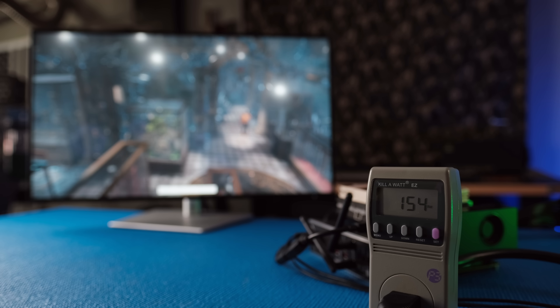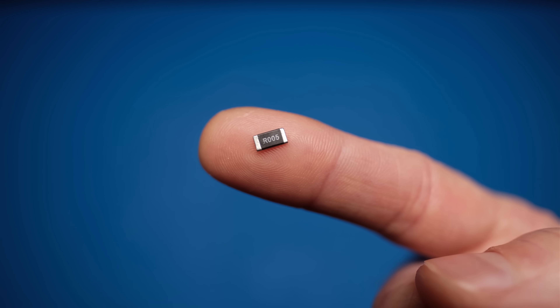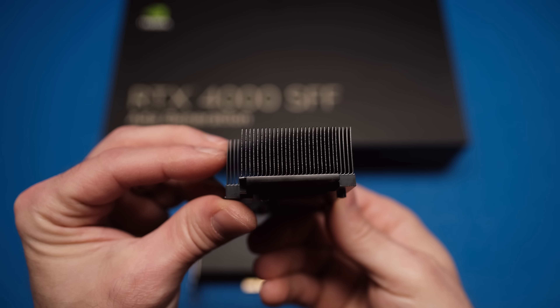Until you level the playing field, the full potential of the RTX 4000 Small Form Factor has been chopped off at the knees due to the 70-watt power limit. We can't change that through software or BIOS flash. However, a shunt mod can be used to trick the card into thinking it's only getting half the power it needs, thereby causing it to pull more. Shunt mods can damage both the GPU and the motherboard — Matt's willing to take the risk, so I'm using a shunt mod to double the power limit up to 140 watts.